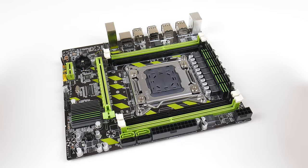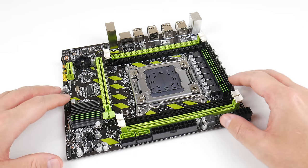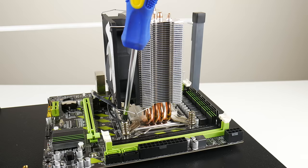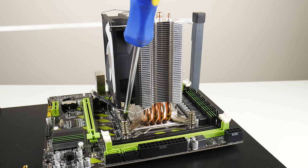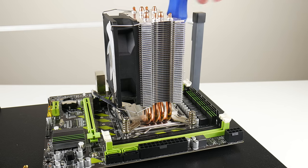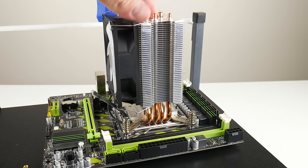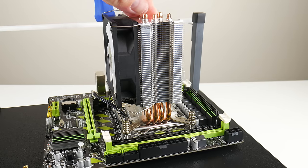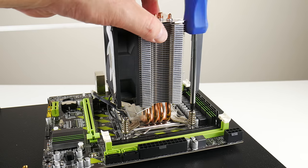This is the mainboard we're using today — it's for LGA 2011. You're looking at around $50 to $60 depending on the model. This one is one of the cheapest versions: no M.2, no USB 3. Also, the CPUs for this platform support quad-channel memory, but this mainboard does not, so we're only able to use dual-channel memory even if you fill all four slots. RAM goes into the green slots, so we're using two modules.